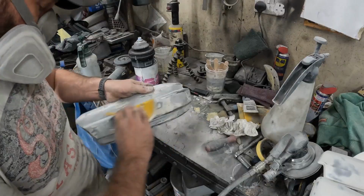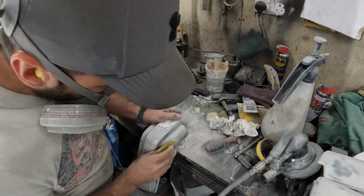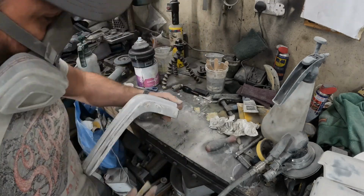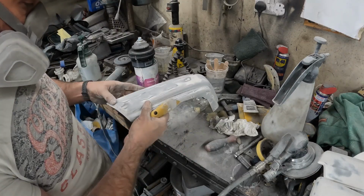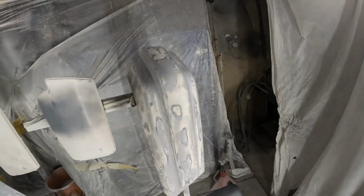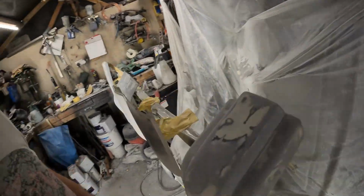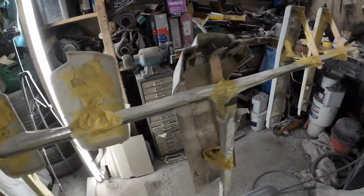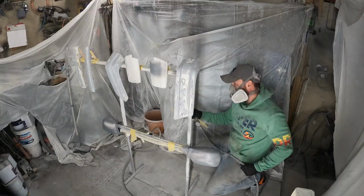And then onto the front bumper end caps and insert. So painted these again late last year just with high build primer, so it's just a case of giving these a good sand back to get them nice and smooth. Anywhere that I exposed bare plastic, again I've just gone over with some plastic primer, mounted them to the frame using the wooden stirring sticks again. They've come in really handy for this. So lots of masking tape, lots of sticks, but it's holding them really solid for painting them, because there's nothing worse than having them blow around.